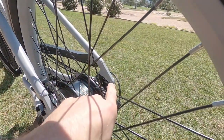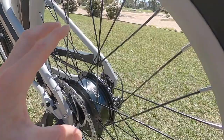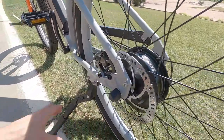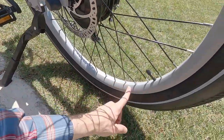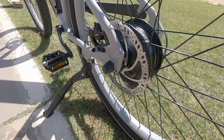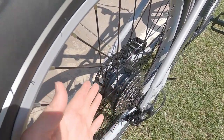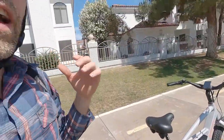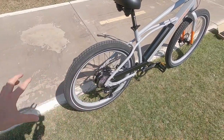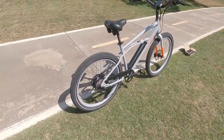There's a great kickstand position and I love the paint-matched rims that tie into the frame — gives the bike a beautiful look. The hub motor has their name printed on it, but unlike some of their other bikes, it's not a Bafang — I think it's another off-brand motor. It's 500 watts nominal, 750 watts peak, with maybe 45–60 newton meters of torque. As I've been riding, the motor noise is a little more pronounced, but it's fairly zippy — I can definitely hear it and it's doing pretty well.